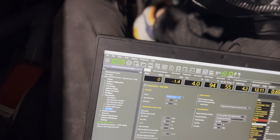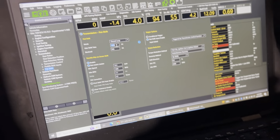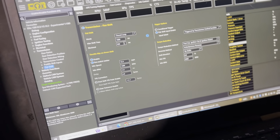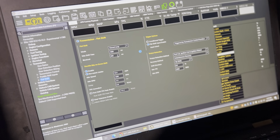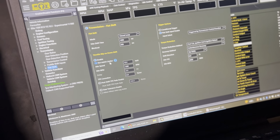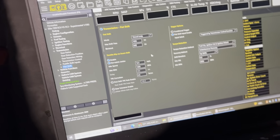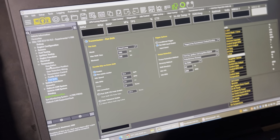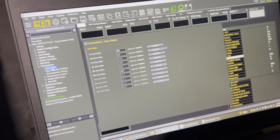This is Haltech, and it's got the transmission control set up. Everything is closed-loop. If for some reason something's not working, it's got a max shift time so it'll expire, and it'll also block out a shift request for 500 milliseconds. It does a throttle blip for you on the downshift and rev matching, so it shouldn't over-rev the engine. It'll know the next RPM for each shift because it knows the gear ratio — those are programmed in.